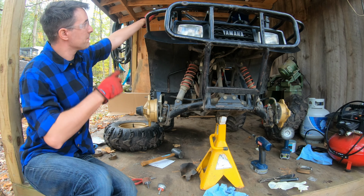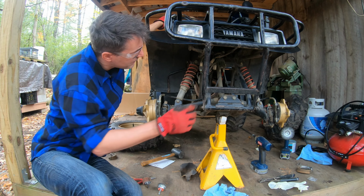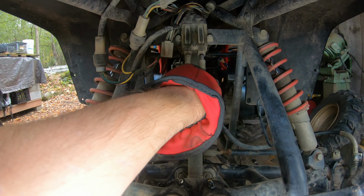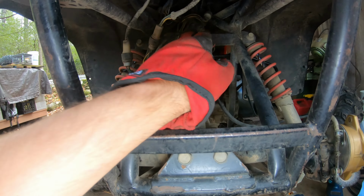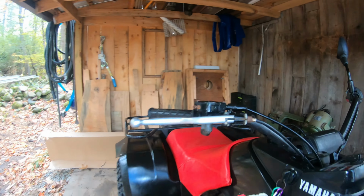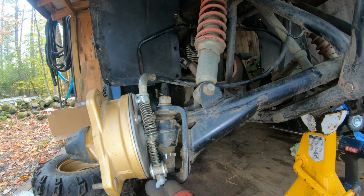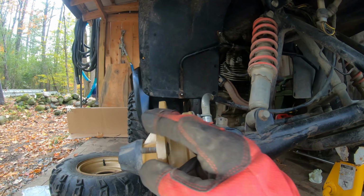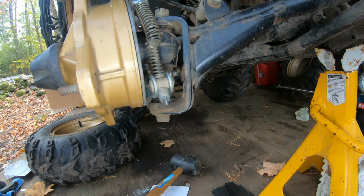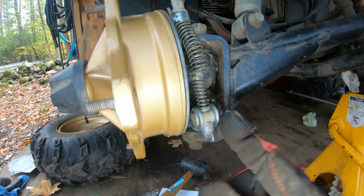Before we put the wheels on, let's go up to the handbrake, pull the handbrake, see how it does for locking things up. And I'm looking in the middle here for the pull. So if you can see that crazy angle there? That's what we've got to adjust out so everything pulls the same. So we're spinning up here. We're actually gonna start, because I like to have this adjustment handy for on the trail, I'm gonna start down here. We're gonna go just until we get drag. And this one's gonna be a little funny because that bearing is not great. We're gonna start with the bottom being flush.